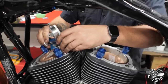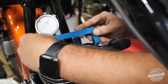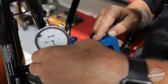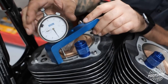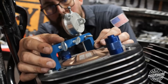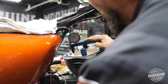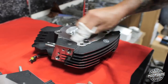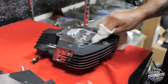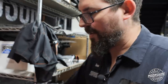So now we take our bridge and zero it — this allows us to set it up. Always center with the pin, make sure you're not on the pop-up. Got to clean them, spray them, clean them, rub them — white glove treatment right there. Don't forget your head gaskets. Check to make sure they're stamped; got a fire ring in there. One side is concave, one convex — basically want the bump down. Line it up, make sure they go on the dowels nice, then we can put our bolts in.